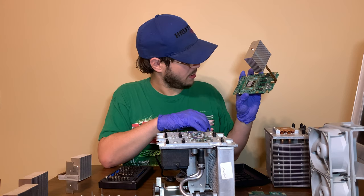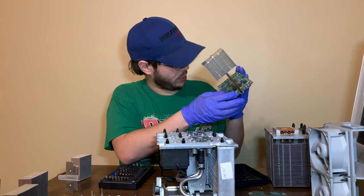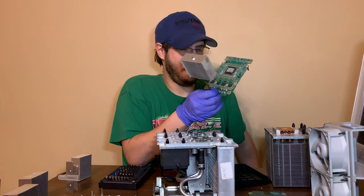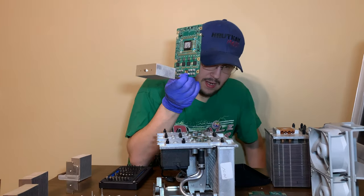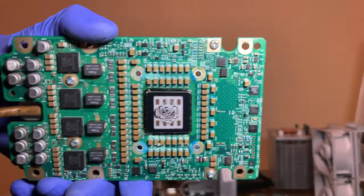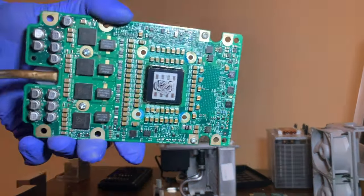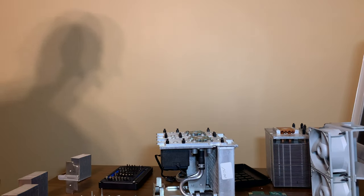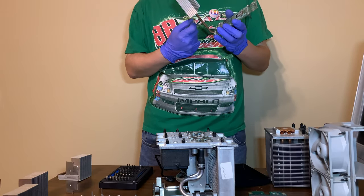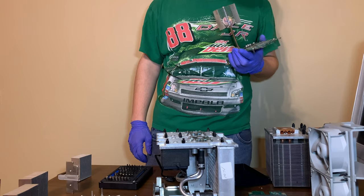It too leaked. It leaked quite nicely. It's also bridged. In fact, a few of these capacitors look worse. In fact, it looks like it leaked worse, but it sealed itself around the CPU. If you have a G5 that's liquid cooled, open it up. This is why. So this card also has to be fixed. So I'm going to take these pegs off and the VRM heatsink, and I'm going to clean these cards off, and we'll continue on after I get the cards all cleaned up.